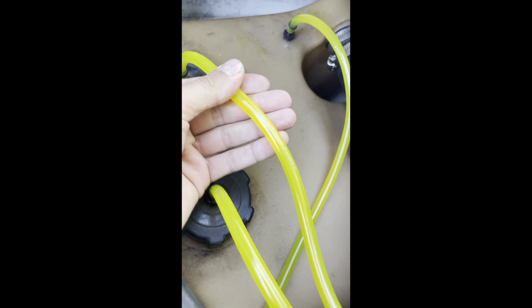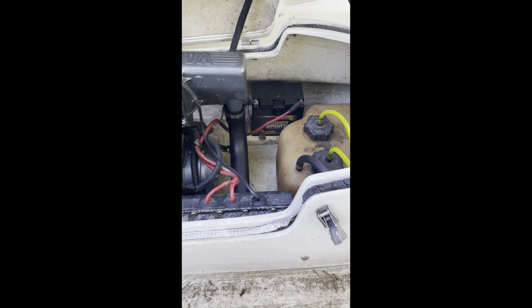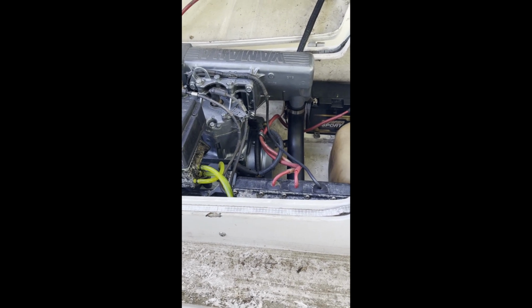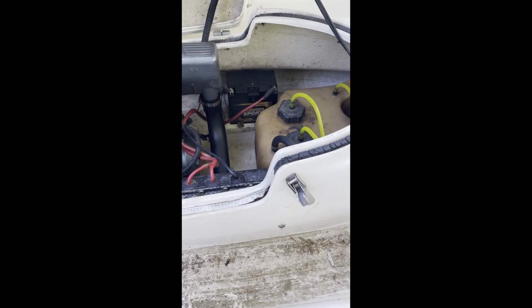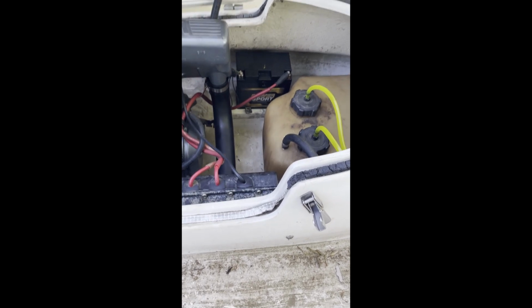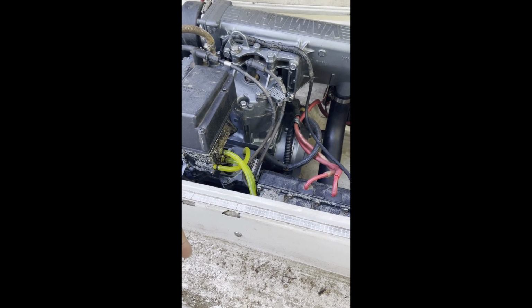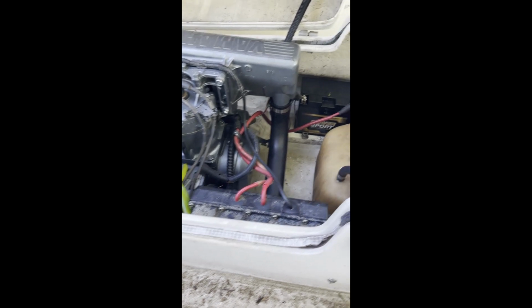These are Tygon, made by Saint-Gobain. I've bought Tygon from a few different suppliers. Honestly, this one doesn't seem super great. I test started it a little while ago, and I just had a little small can of gas, and I put the end of the fuel line in the gas, and it kind of expanded. And so when I took it out of the gas to stick it back on the petcock, it was loose on there. It wasn't tight anymore. But I got them all zip tied on there pretty good. Hopefully none of those pop off or leak or anything.